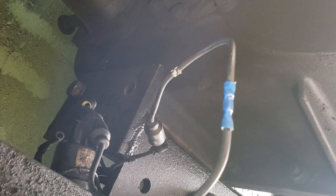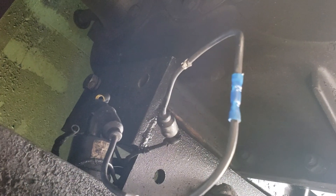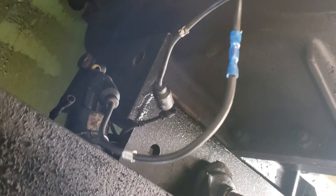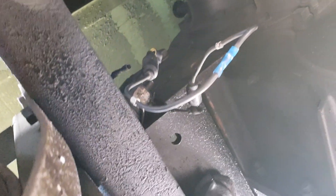The front wire is always the power in. Take it off and see if you have power coming out. To learn if the switch is working or not, you need to put a weight or whatever on the brake pedal, then see if it comes on.